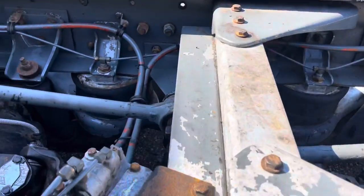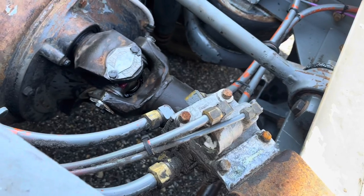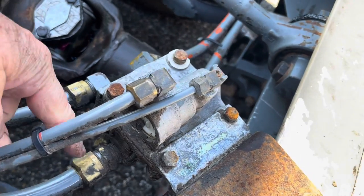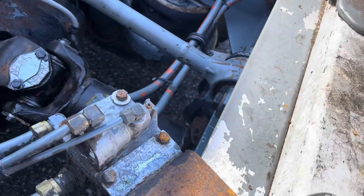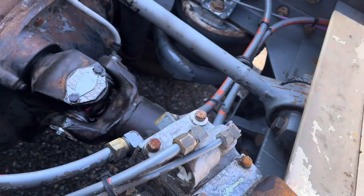And it should be, but I don't think it's going to be, and this is why. So here we are at the Kenworth, and this is the brake relay valve for the Kenworth. Now, the difference is the Kenworth only uses one valve instead of two, so there are four outlets that will go to all four rear wheels, and then you still got the signal lines coming into the top. Really different design, but the concept is all the same.